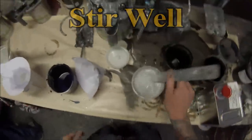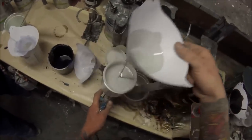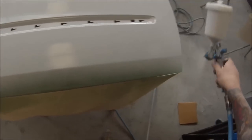Just make sure you give that 2-pack primer a really good stir. A lot of apprentices don't stir it up properly and then they're spraying half hardener over half of the jobs and the rest of the time they're just spraying primer filler. I wouldn't usually have mixed up that much primer just for this door, but as you saw I'm doing a batch of putty-outs, so all I'm actually putting on this door is just 2 coats of the primer surfacer and it's not going to need any blocking at all because it's back to a brand new door. That's another risk of paint stripping — you're not to know what's underneath. There could be old repairs and you may have to carry out some body filler repairs.